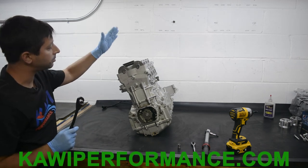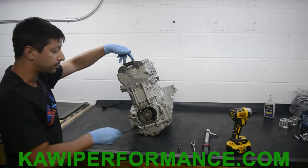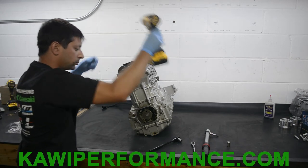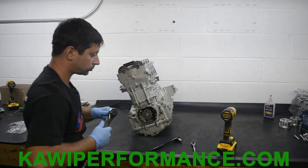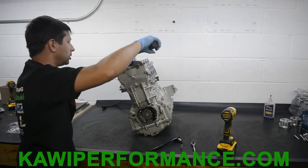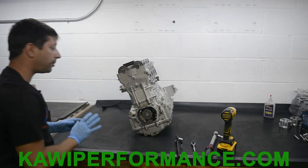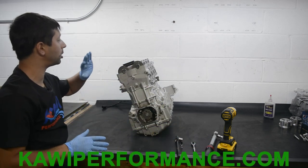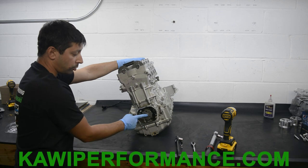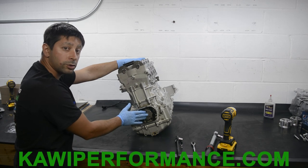The last piece of this setup is to tighten and torque these two bolts here, and we can do that now. Okay, I would recommend definitely double and triple checking to make sure you torqued everything properly. Go over everything. As far as this bolt here, which we did not torque in this video, it's a little more difficult. We like to put red Loctite on it and it also gets 12 foot pounds.